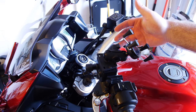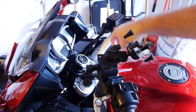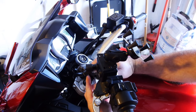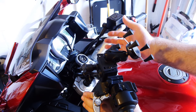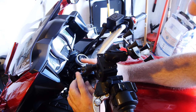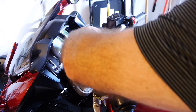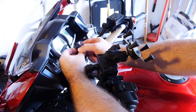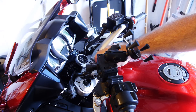If you have an A model you can skip this step. If you have an ES, you can give yourself a bit more clearance by peeling back these boots and disconnecting the suspension adjustment connections at the top. It is possible to carefully lift the whole assembly and just barely clear them, but disconnecting is easier — there's just one push tab, you wiggle it up. Now we have to remove our center nut.